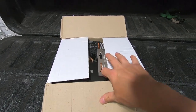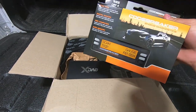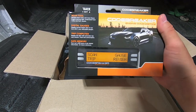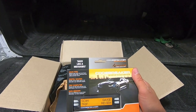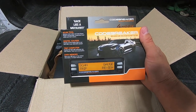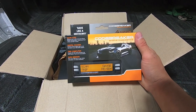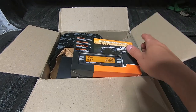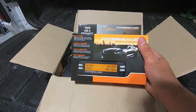Let's dig into the box. There are two truck parts in here and then some apparel items from Ultimate Nine. The first truck part is the Code Breaker. This is one of the OBD devices that they offer. Basically what this does is two things: one, it can serve as an OBD tool — so if you're ever having a check engine light or some sort of warning on your truck, you could plug this in and read the error codes through the scan tool side of it. It can also operate like a digital gauge, similar to the Bank's iDash, where you plug it into your OBD and it reads all your PID values from your ECM.